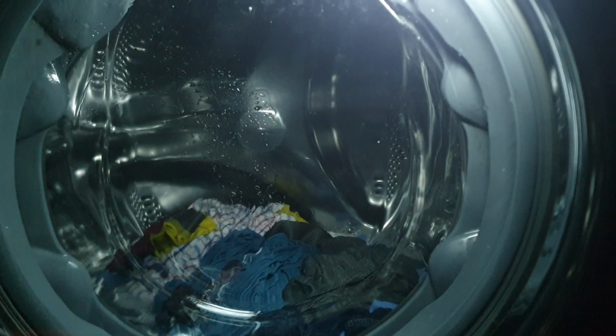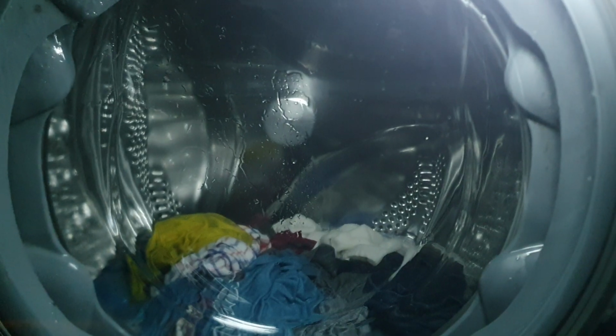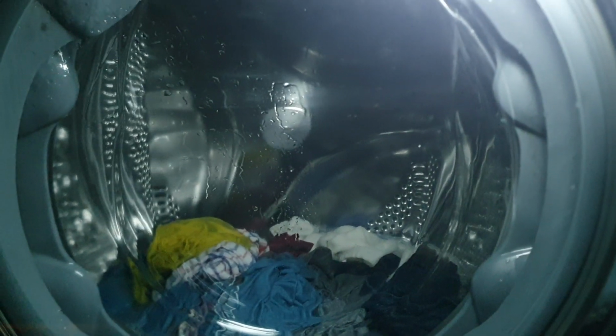The load's skimming the paddles now. The wee small paddles. Got the Maloney speed bump style. But that's good though. It's actually giving it time to rinse and doing tumbles, whereas the Turboclean cycle just filled up and then drained. So this is giving you a much better rinse with the full jets full on. That's brilliant.